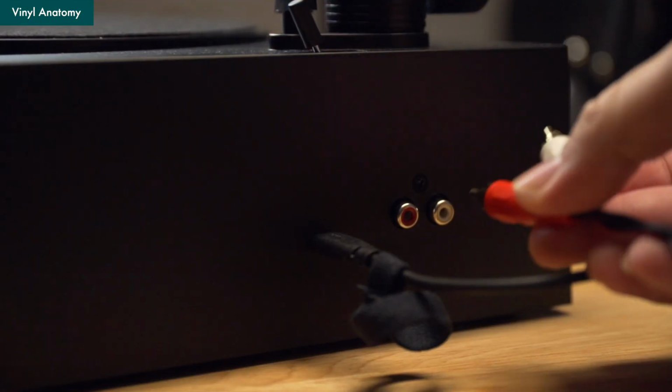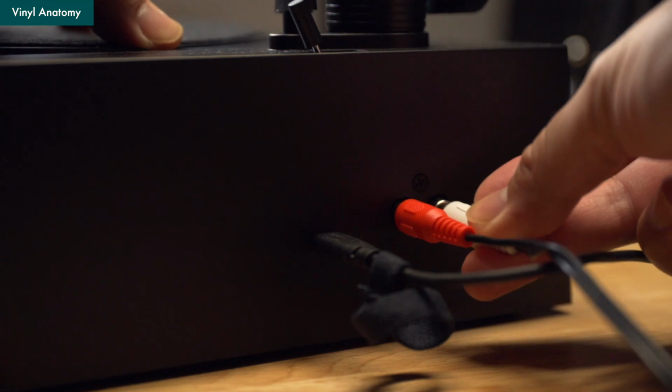With the build taken care of, here are my experience and thoughts about the turntable. One of the most bizarre things about Obegransad is the RCA to 3.5mm cable. When I hook up the turntable with a standard pair of RCA cables to my system like you normally do, it only plays mono. The right channel plays, but the left is dead silence. I tried different cables and different components to narrow down the problem, and it is indeed the turntable. I even tried using an adapter like this to turn the 3.5mm jack back to RCA, but that doesn't work either. It turns back to mono.